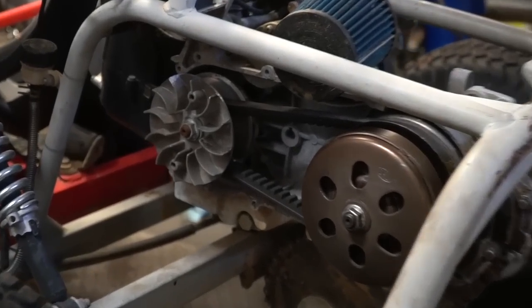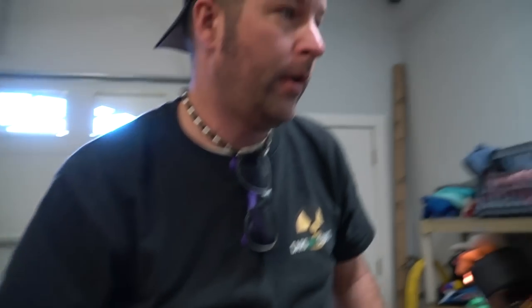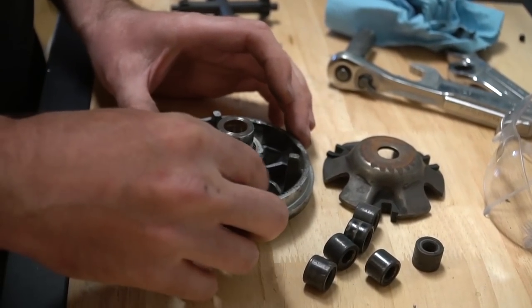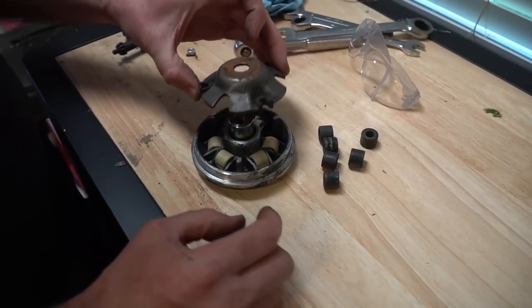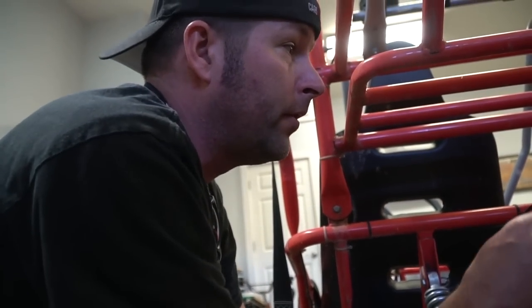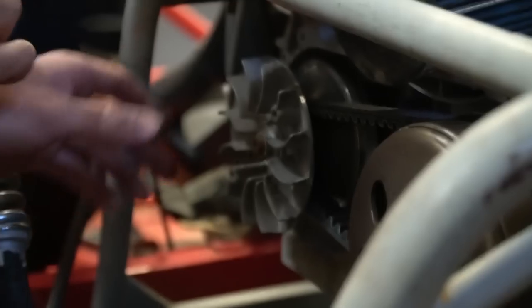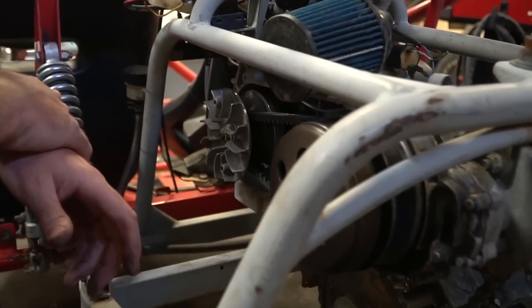The rollers we're going to replace are in the front pulley. That's a piece of cake — it's so easy. We are going to go ahead and install the new belt too. The old one looked like it was in pretty good shape still, but might as well put the new one on. One thing I should have done while spinning this over is disconnected the coil, because that thing could have cranked up with my fingers in it. So you should disconnect the coil before you turn the engine over doing stuff like this.